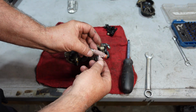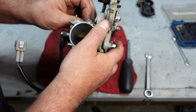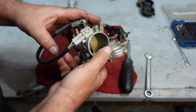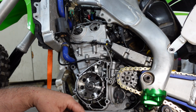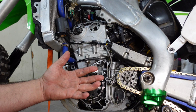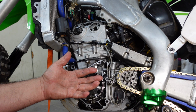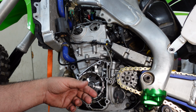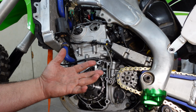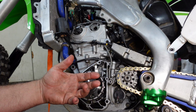The injector definitely looks new. The seal looks good, so no issues there. All right, I've gone all over these systems with a fine-tooth comb, still doing the same thing. She will not idle. I have to hold throttle, and in fact I have to give it about half throttle just to get it to start. She revs up fine, but just will not idle. It feels like it's really dragging and just wants to shut down.